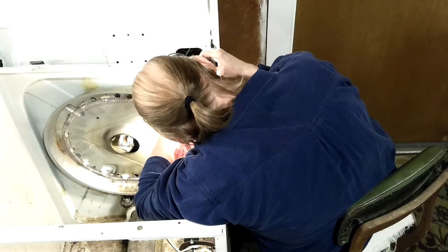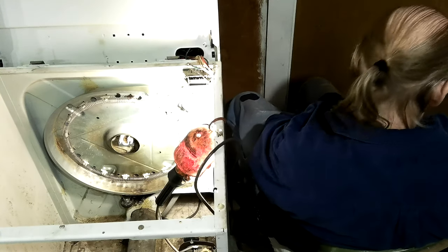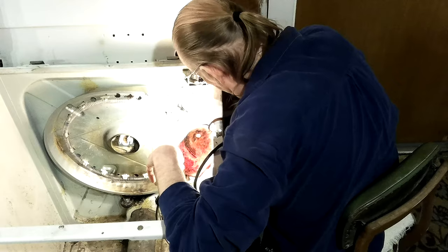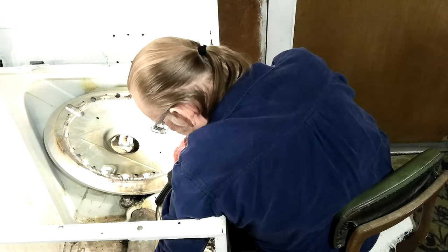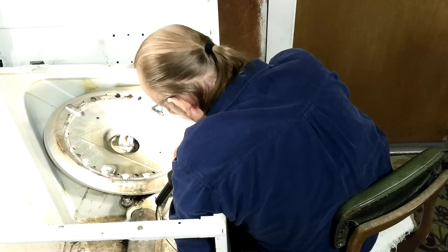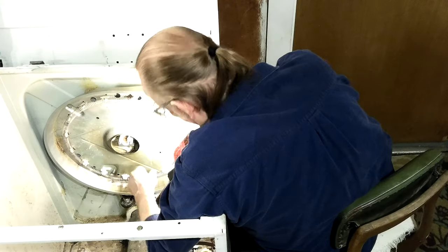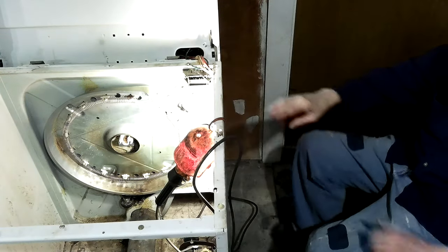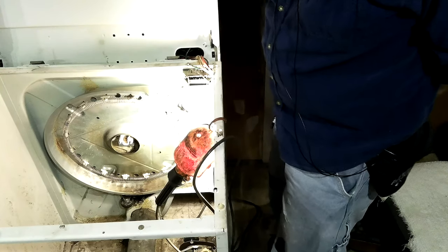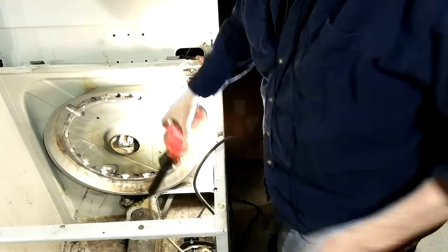Okay, let's think about the test. I can test this just like it is — just plug it in and test it. The blower will be blowing air but it won't be circulating through the heating element, because what it does is suck air through the drum and out the back, forcing air across the heating element. So if I turn it on, it's got to be just for seconds. I'm going to turn it on for seconds, see if it turns on at all, and then I'm going to go eat while it cools down.